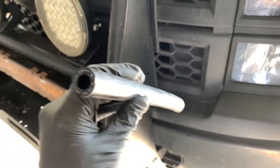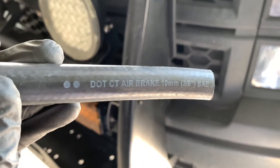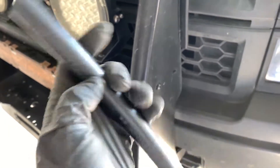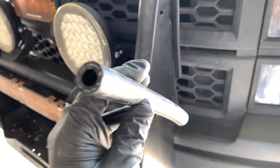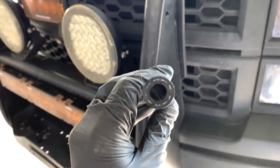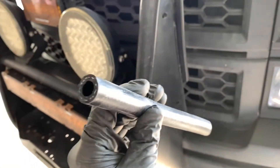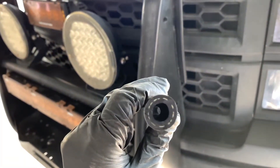The last thing that you're gonna need is a couple of feet of this line. This is an air brake hose which is 3/8 inch inside diameter, and this is a very hard line. This is going to carry the vacuum from the intake manifold to your brake booster, so you have to find a hose that is 3/8 inch inside diameter, hard, and will resist the vacuum.